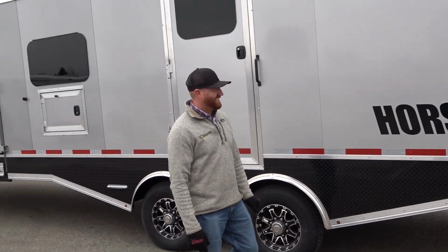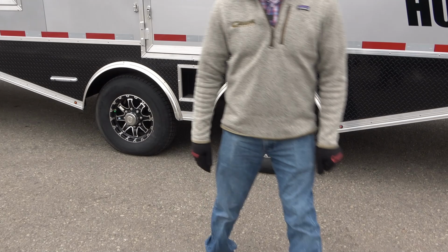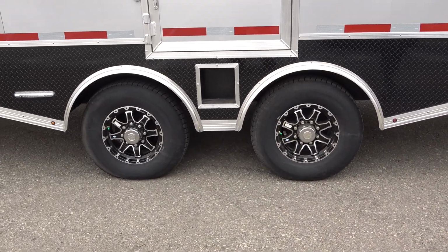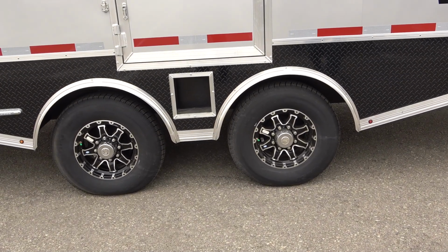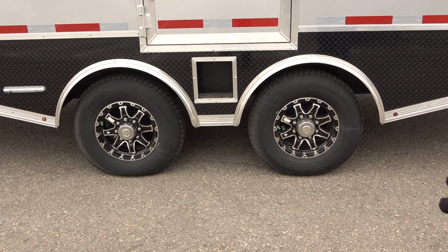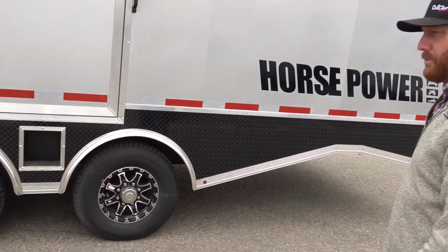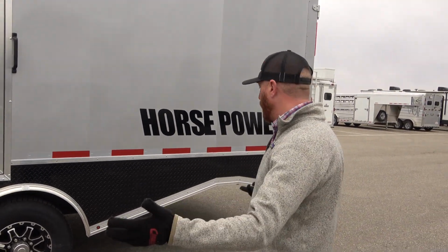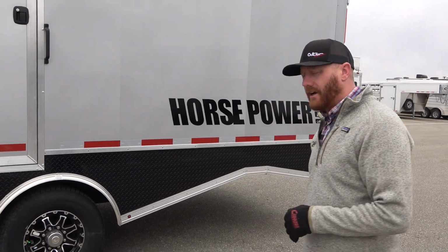It's all electric hybrids. Well, let's look at this puppy. Look at the bridge on that. It's got the spread axle that actually distributes the weight, does it? Yeah, spread axle really helps with the way these trailers pull, but more importantly with weight distribution. When we spread axles back here, we take away some tongue weight on some of these trailers. You're going to be able to put a lot of stuff on this since it's 31 foot on the floor and it's a box, so you have the capability to throw a lot on this trailer itself.